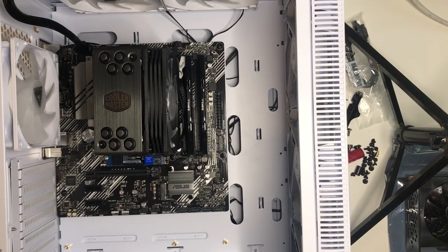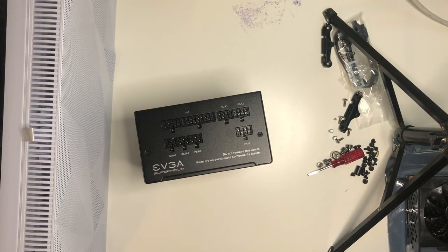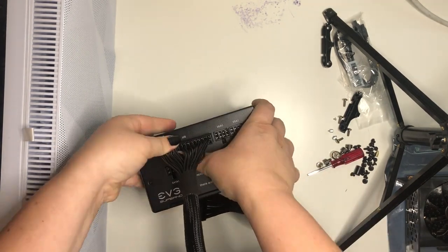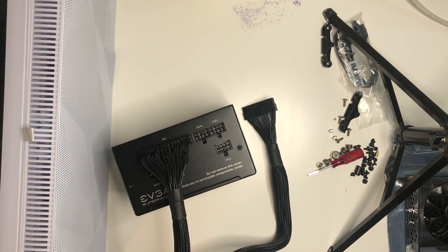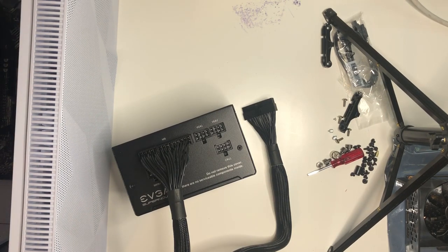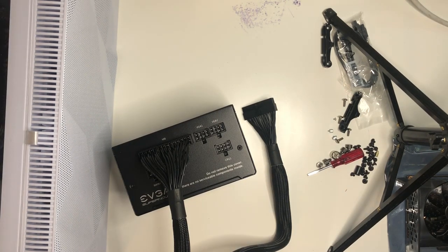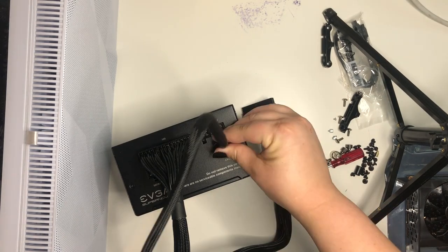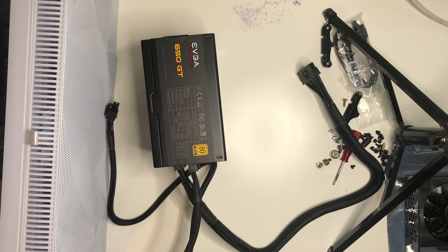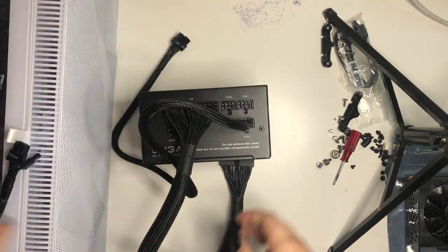Mostly because I got in there and thought I had them in place, and then I was like, oh, here's another hole. Oh, here's another hole. I kept forgetting ones. I'm not really sure how to help you avoid that, but just double and triple check your motherboard and make sure all of your holes have pegs so that it can be mounted safely. That's probably my biggest one there, because it is super frustrating to pull your motherboard back out, add something, put it in, and do it all over again. Super frustrating.